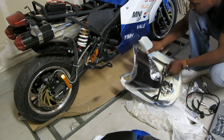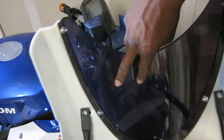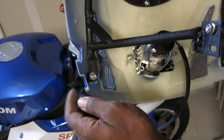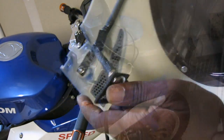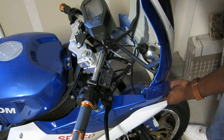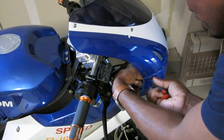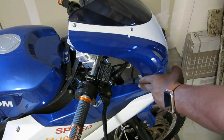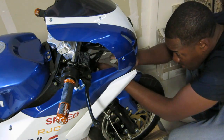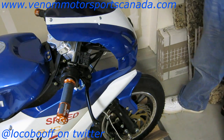The front mask: all you're going to do is put on the plastic front windshield right here — only two bolts hold the front nose on. There's one bolt here and one on the other side. You also have two that mount to holes on the inside of the frame. Get those in there, tighten them up, and you're good to go. There's one plug to plug in for the headlight — a three-prong plug matching right in the front of the bike; it can only go one place. And that's it — installation complete.